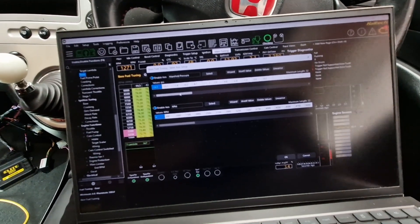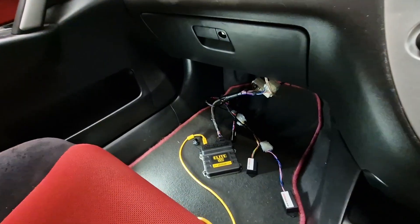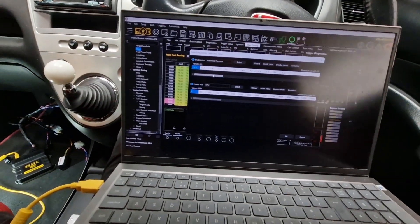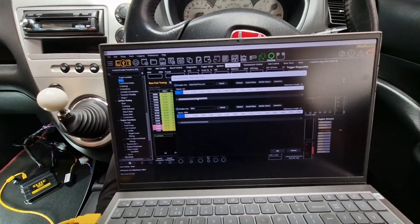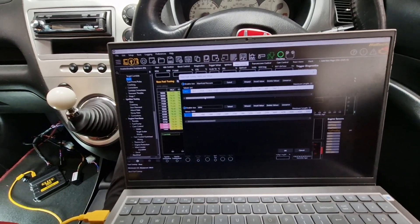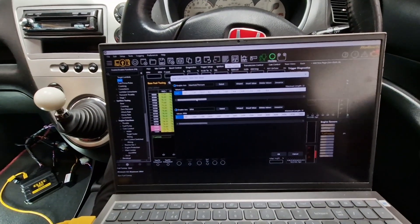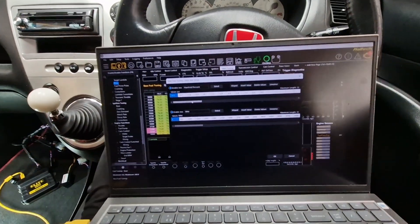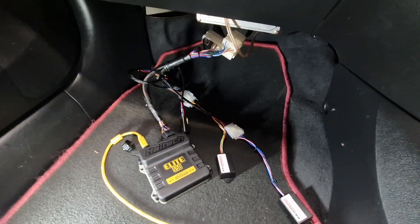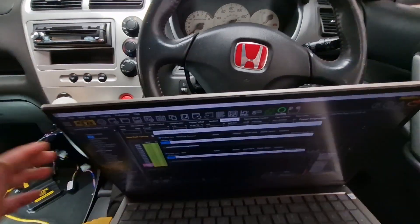We can also easily run things like ITBs on the car. We are a bit limited with IOs on this entry-level ECU, but the great thing is with the IC7 dash and the 10-inch one coming out, we'll have a lot of expandability — quite a few spare configurable IOs, working like a PMU, all programmable through the ECU software. We'll be able to configure the dash, add extra sensors and outputs, which is quite nice. All in all, it gives us great expandability on what is a very cheap entry-level ECU, configured how we want with this conversion harness. And as far as I know, it's the first one in the world to actually run with the dash and everything functioning as it should with the multiplex.